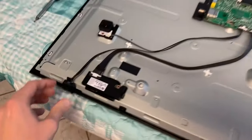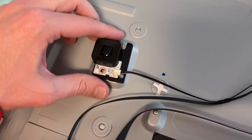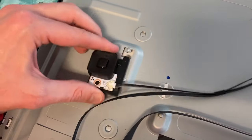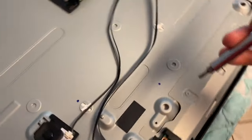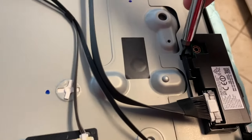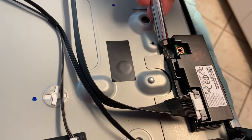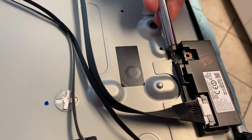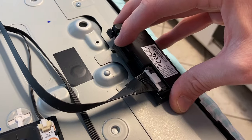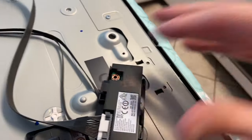Back to the panel — you've got your remote sensor; shift that out. You've got your power button; it just shifts out. This is the only time I'll use a flathead screwdriver tip, and that is to remove this wi-fi module. Insert it and carefully shift the wi-fi module up — this is plastic and the last thing you want to do is break it. After shifting that connection up and out, the opposite side will shift out very easily.